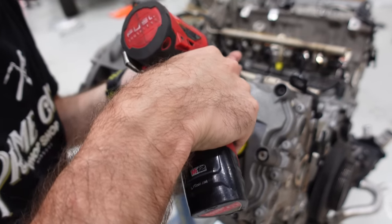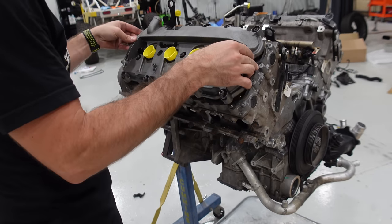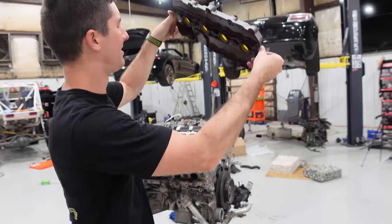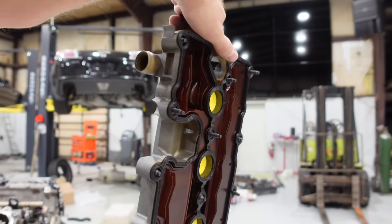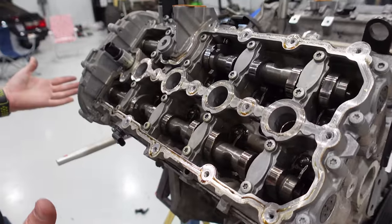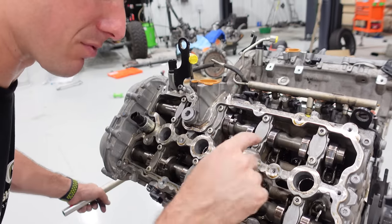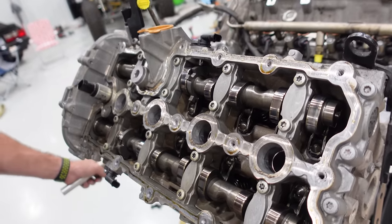I didn't know you could put this many screws in a valve cover. These are plastic — I always thought they were metal. That's wild. Well, they're very well done. There's the inside of the valve cover and it looks brand new. All the crankcase ventilation, everything looks great. The inside of the engine also looks brand new, as you'd kind of expect for this car only having 54,000 miles on it. The lobes are incredible — these lobes get profiled in basically 3D. There's a normal cam lobe and then the sides are chamfered; they kind of roll off. That is impressive.